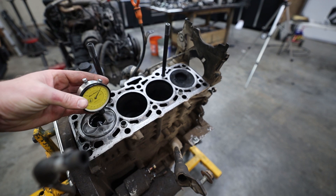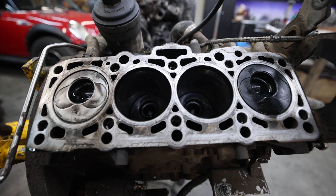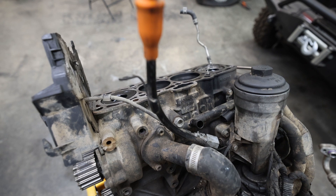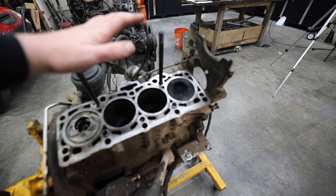Years ago I made a little adapter that would work with a dial indicator so I could put it on top of a piston and make sure we don't have any bent rods. That was the plan for this video — tear down the bottom end, tear down the top end, make sure everything is good before reassembly, because we just assumed we had an injector issue. But when I came back out and wasn't exhausted, I looked at that piston and we have a big problem. I cleaned off all the carbon, and this piston is lower than the deck of the block while the others are almost identically the same height. Clearly this is bent — no measurements needed. If you can see it and feel it, that's already a big problem.